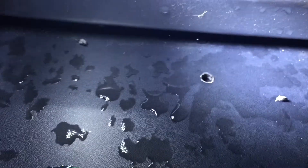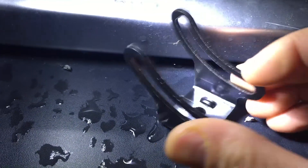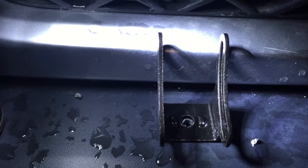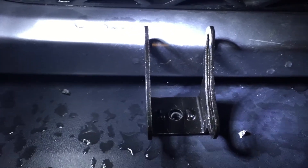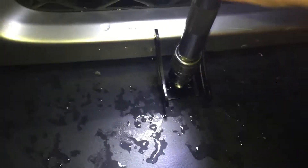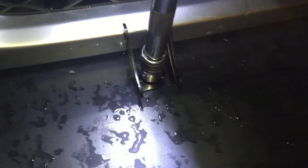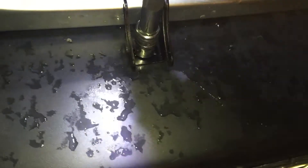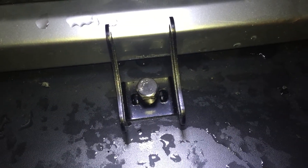There's the top of the bumper now with a pre-drilled hole. I'll slap this on — that will be the bracket for the auxiliary light. There you go, just need to tighten it up. I'll ratchet it, put a nut on the other side, and add a lock washer. This is what a finished bracket looks like.